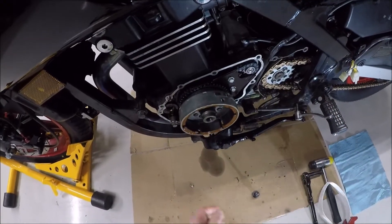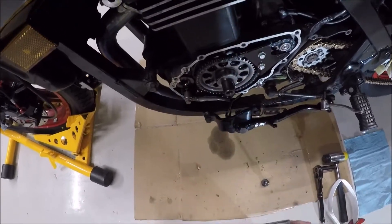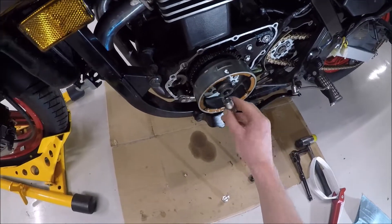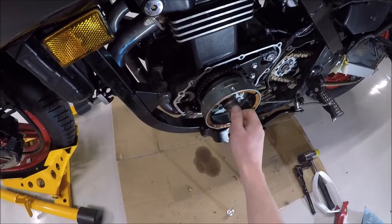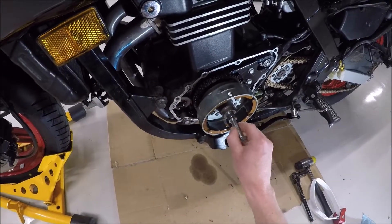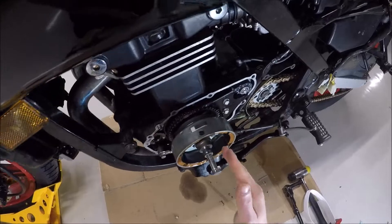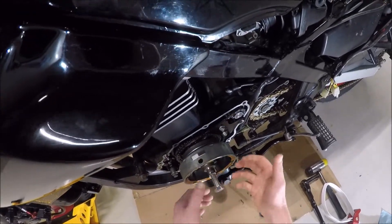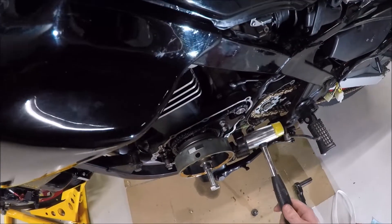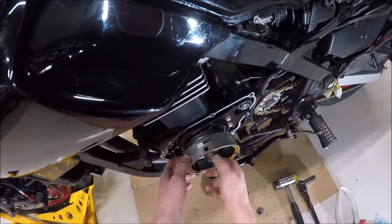The bolt holding the flywheel comes off and the flywheel comes loose. The starter clutch just falls apart when you remove it. When you go to remove the flywheel it'll actually be very stuck, so with the flywheel puller tool — which is right-hand thread — you thread it all the way in, hold the 17mm flats, turn the 19mm bolt, and it'll pop off. The issue is it can damage those inside threads. I learned I probably should have used some heat and lightly tapped around it with a soft hammer first.